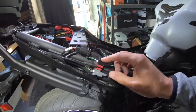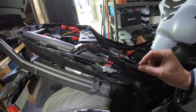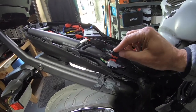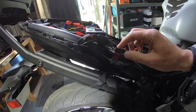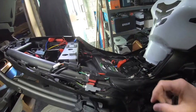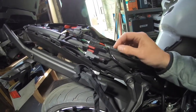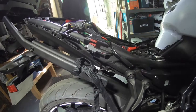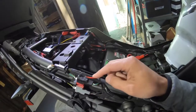What I've done on mine - I probably wouldn't do it the second time but it's not a bad way - I took off the side panel and found these connectors for the rear lights. When I pulled these connectors apart I put a multimeter on there, played with the ignition switch, and when the ignition switch was on these wires became live. So I shaved off the insulation with a Stanley knife and soldered on my live feed, which you can see - that red wire there.